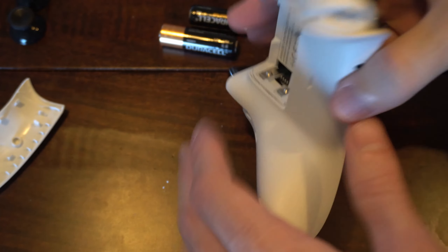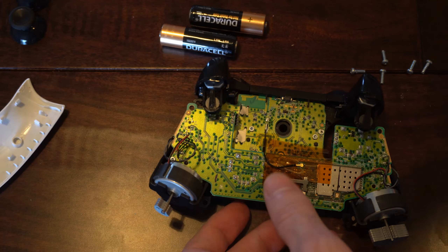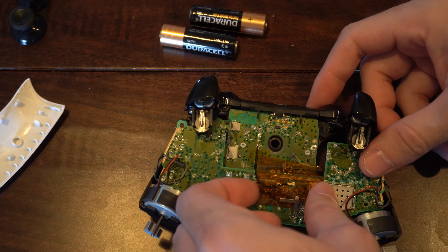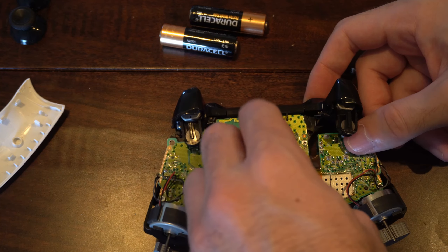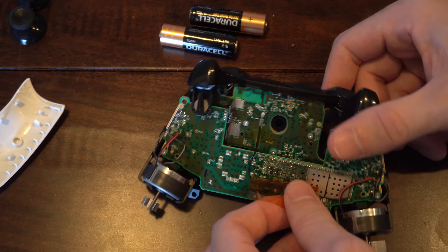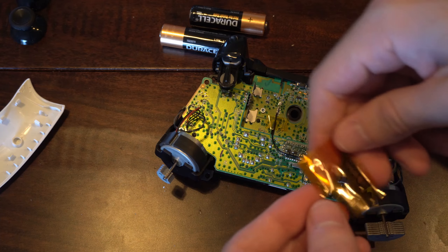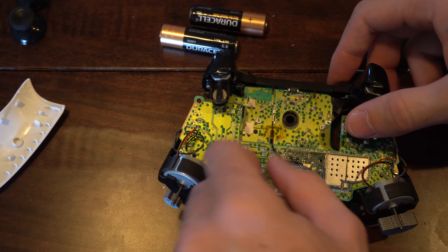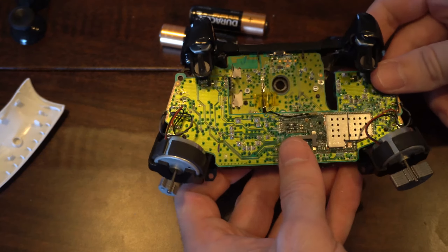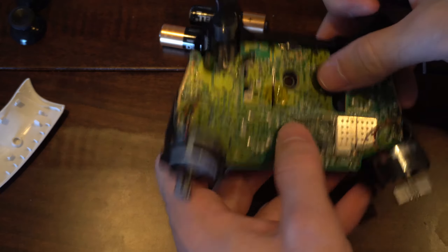We're going to take this a little bit further now and remove this back cover, which is going to get a little bit more tricky. You can see I have this one cable here and a piece of plastic that's covering it like tape — we're going to need to remove this to get down further. We're going to want to remove this little ribbon cable. Then we're going to have four screws right here, here, here, and there. I believe this is a T6 screwdriver here.